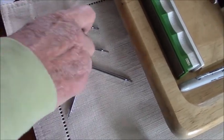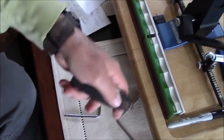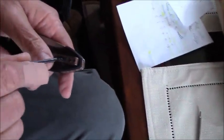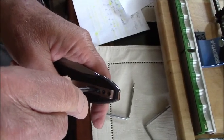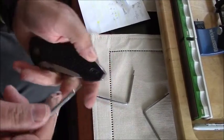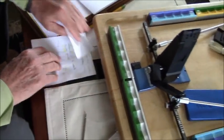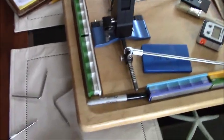And it really isn't necessary. You could simply play until you find that, okay, let's say I used the other 1, 2, 3, 4 and it didn't work. Process of elimination. I put this in here and I can feel this now. It's going to grab very, very tight right now. I can loosen it, which I don't want to play around with right now. But that's how you would remove the clip. And you need the Torx 6 for that.